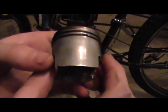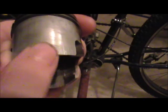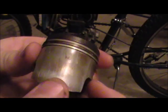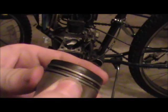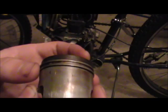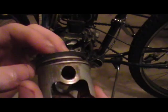Alright Tubes. You can see there's some scoring on this piston. It's shiny right here on the skirt. On the intake side it's shiny; on the exhaust side there's a bunch of marks on here. These were all here before I took it off the scooter. This is from using Mag-1 oil and that's why I hate it — or at least that's what I blame it on.